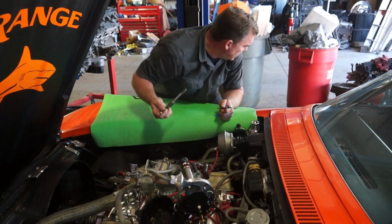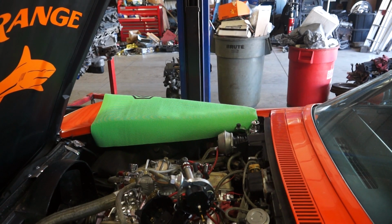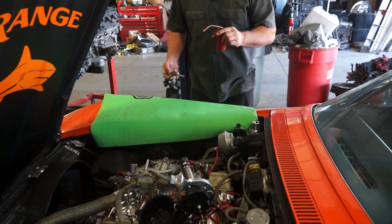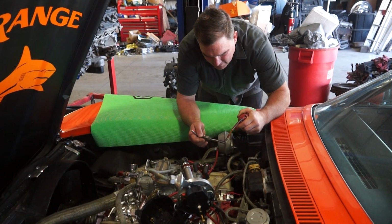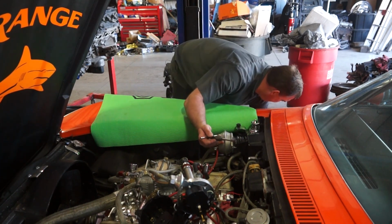I need a little oil. When you go out, it does shake. When you accelerate, it wobbles and shimmies. And if you let off of the gas, it... Oh, I bet it does all sorts of stuff because the engine torque strut's broken on it. Yeah, the CV joint down there is ripped open and then the mount's missing, so I need to put that stuff on there. Yeah, that's a good place to start.